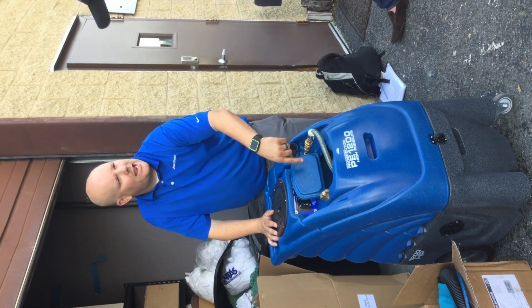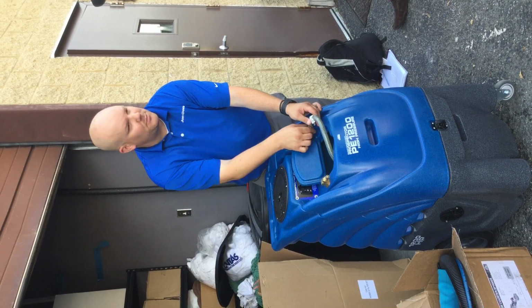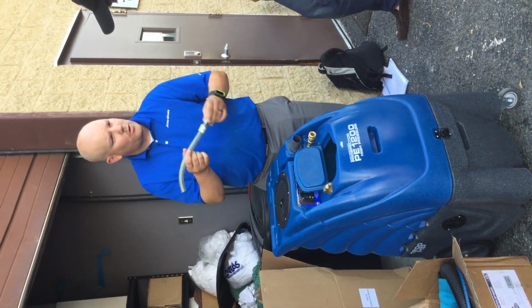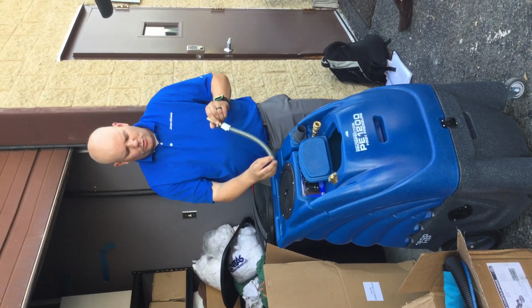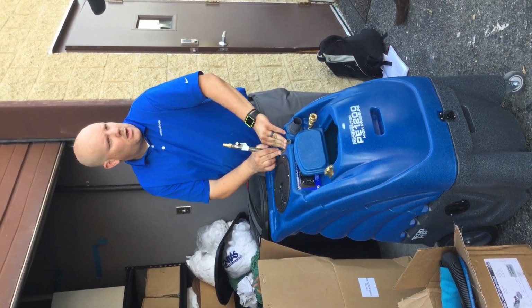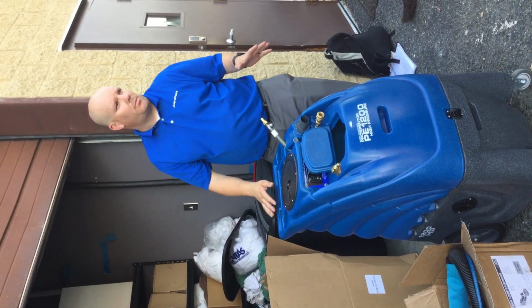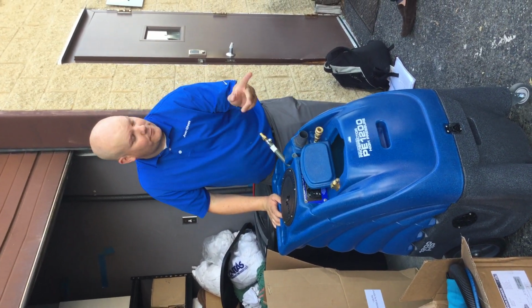You're going to filter any air out of the line, and you'll see air bubbles in here. When it's all water, you're just going to stop the machine, turn it off, and take it off. You don't have to worry about burning yourself with it because there's no heat. You do not want to put hot water in here; it'll mess up the pumps. You can use lukewarm water or just regular warm water. Don't put hot water in it because you don't want to break the pumps. That becomes very pricey. Don't let it freeze like we talked about.